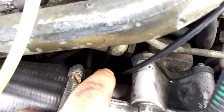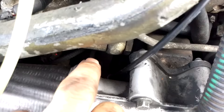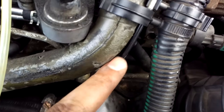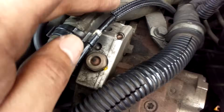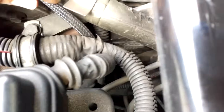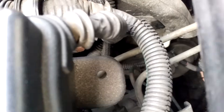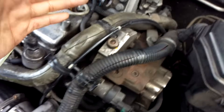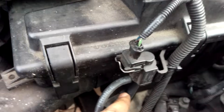There's a T-junction just down in there — one half goes to the boost control solenoid, and there's a video on my channel showing you how to clean that. The other part of the T then goes to the vacuum pump which lives just on the edge of the engine. If you trace that down it goes into the vacuum pump which is cam-driven from the engine.